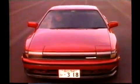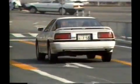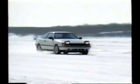While the anti-lock system is functioning normally, the brake pedal may pulsate, and the vehicle body and steering wheel may vibrate. Do not take risks. Because you have an anti-lock brake system, you must still keep a safe distance from the car in front of you. In fact, the braking distance of the anti-lock brake system may be longer than that of conventional brake systems. Always reduce speed when cornering and when roads are rough or covered with snow or gravel.